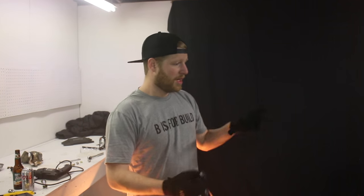We found the source of the exhaust leak. I mistakenly forgot to tighten down the whole left bank of the exhaust manifold. The three bolts on there and the gasket were just hanging off, completely detached about a quarter inch - that's why it sounded so bad. That's a serious exhaust leak, and in fact it was. So let's go try and turn the car on again.